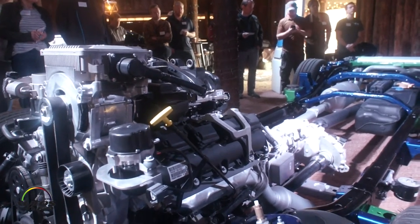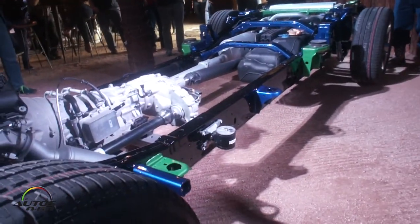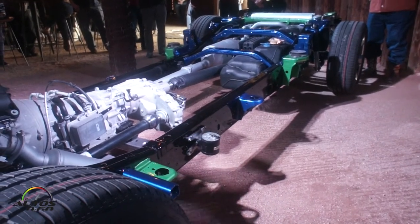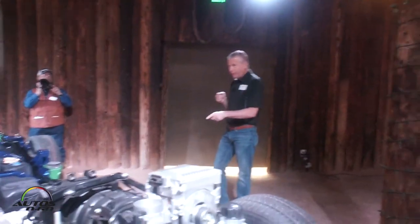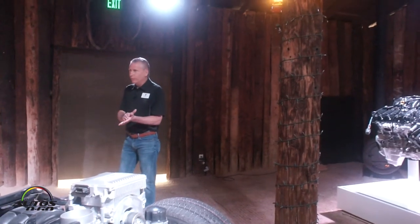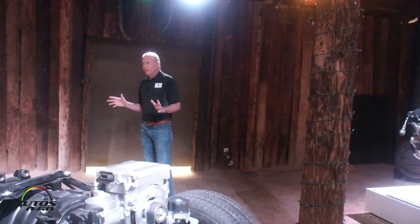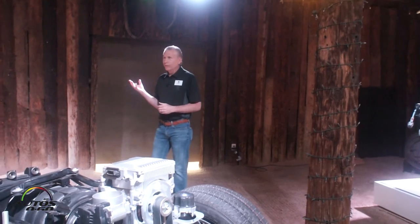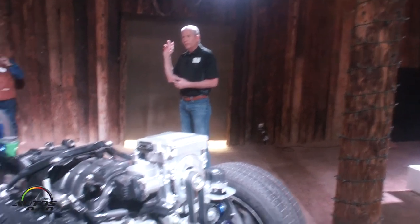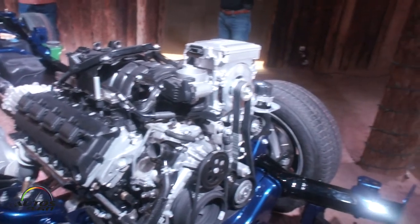Before I hand it over, these modules here are our ATMM — active tuned mass modules. They enable us to extend our fuel saver mode, which is when our Hemi engine goes into four-cylinder mode. When the frame picks up vibration from that calibration, the modules shake internally at 180 degrees out of phase and cancel it, so the customer feels nothing in the steering wheel, seat, or floor. There's also an audible side addressed by ANC — four microphones in the headliner pump noise cancellation through the speakers and subwoofer. The customer simply enjoys better fuel economy.